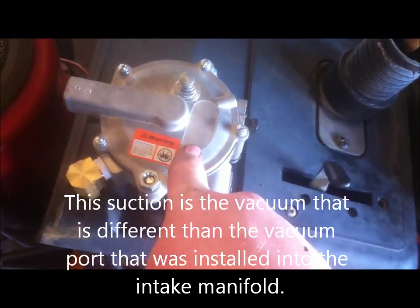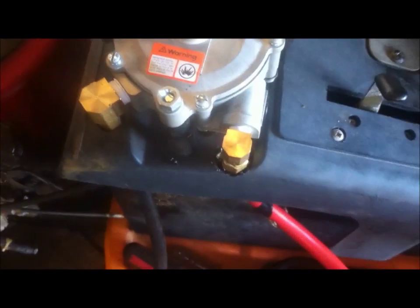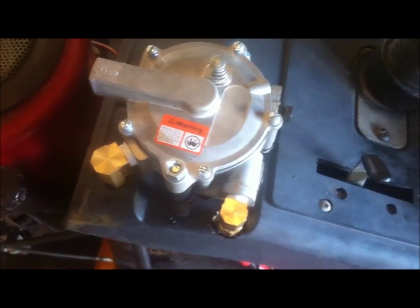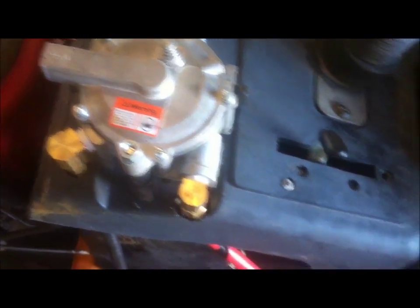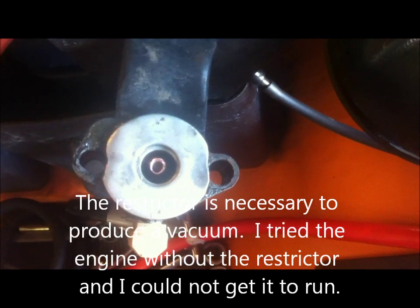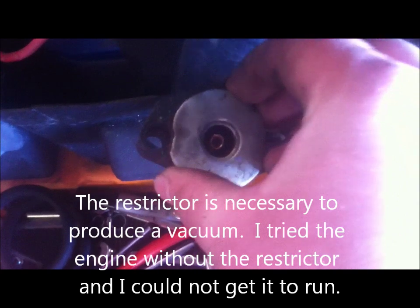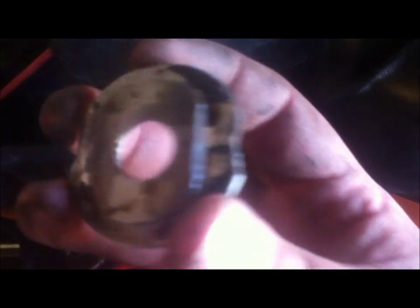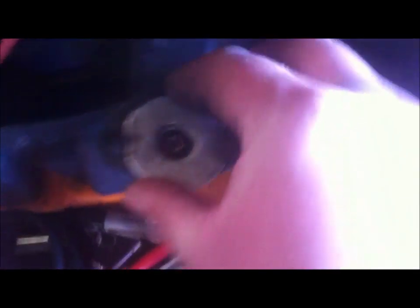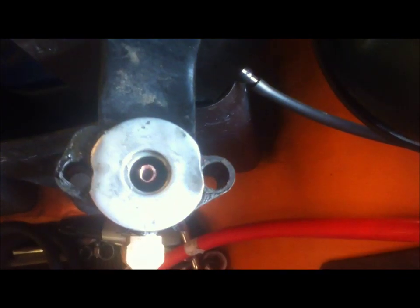This regulator is a negative pressure regulator. So in the event that this hose got cut going to the carburetor, it's going to shut off the flow since there's no longer any vacuum pressure being applied. This is similar to a mixer you would see on some of these conversion kits for 30 or 40 bucks — it's a brass fitting, copper tubing, a couple washers, a little grinding on the washers. I did tack weld them together just to hold them in place, and I bent the tube in here to where it was pretty well centered.